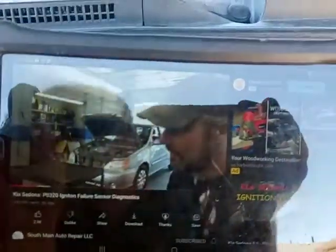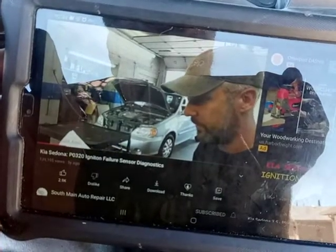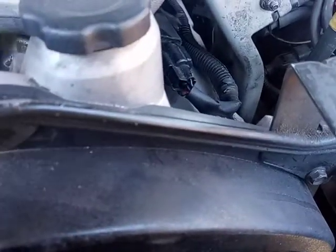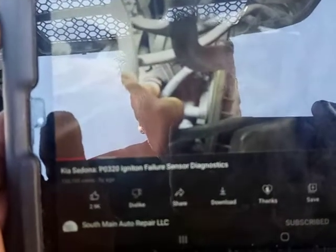It's written kind of funny, but I got a wire color chart here to see what it is. It says the sensor is located next to the upper radiator hose and back of the cylinder head, so let's have a look. Back here, with the little engine cover off, it appears that it's this sensor right here — it just bolts to the engine. It has a ground, an IGF, an IG plus, and a VB — probably vehicle battery. Ignition plus, IGF — you can see that sensor.